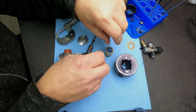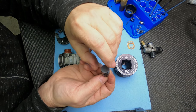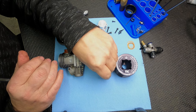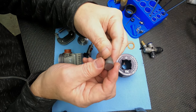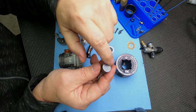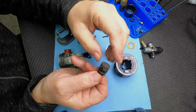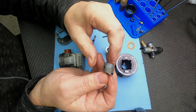When you send a piston and sleeve to resize, I also clean the piston top. I put a little WD-40 on some really fine grit wet-or-dry sandpaper on a surface plate, and run it back and forth. You have to be careful not to round the edges - I've seen some guys use a polishing wheel in a drill and then they round the corners. You don't want to round the corners. Only in extreme cases will I touch up the outside of the piston. The darkness on the piston doesn't matter as long as things are clean.